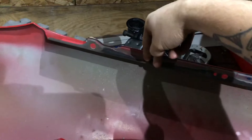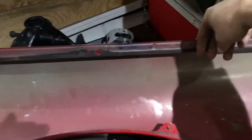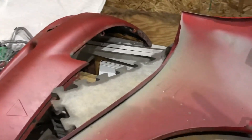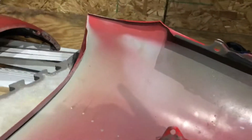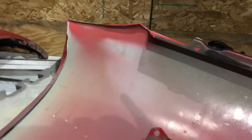That clip shouldn't be too expensive to replace. Keep that panel popper because you're also going to use it to break the glue up here on top of the fender — just lightly slide it underneath and gently pop it back and forth. Don't open it all the way; you don't want to bend the metal. The panel popper is about a ten-dollar tool — I showed it in the door panel removal video if you want to see what it looks like.